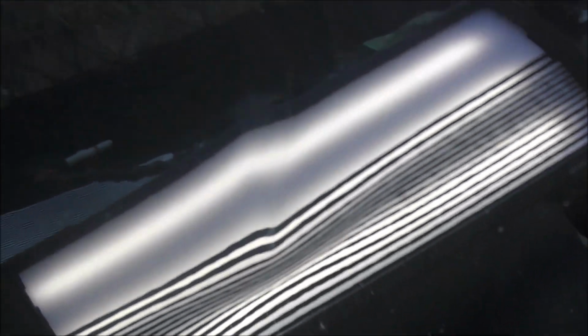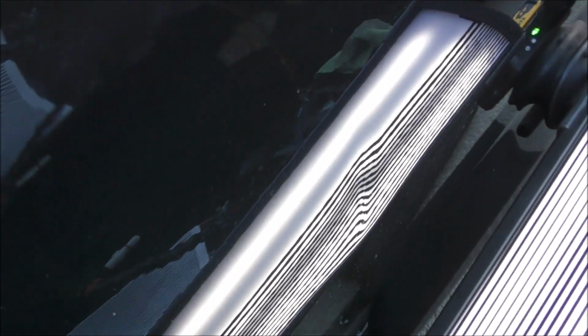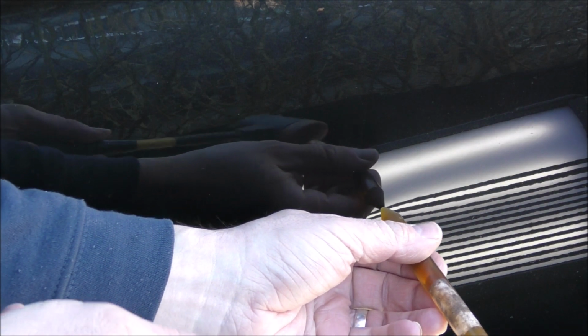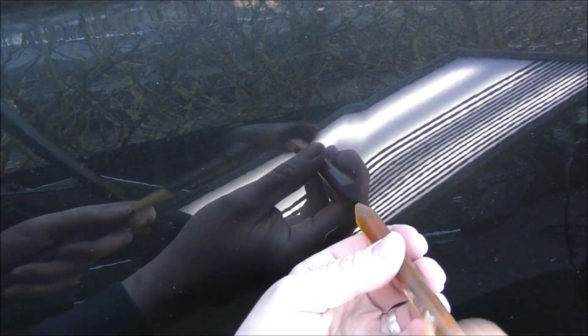For today's repair, I'm using the Lima Dent V3 Lite, and I've gone for a hybrid lens, so half lines, half fog. Now as you can see, we've got quite a crown there, so we've got the main vertical dent that runs down from the impact. So the first thing I'm going to do is start releasing the tension and tapping down that crown. So I've moved my line border up to really show those lines pinched together, and just with a root beer tap down, plenty of patience, just starting to release the tension and tap down that crown.